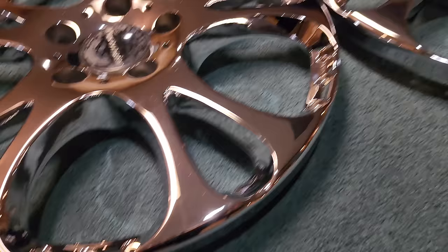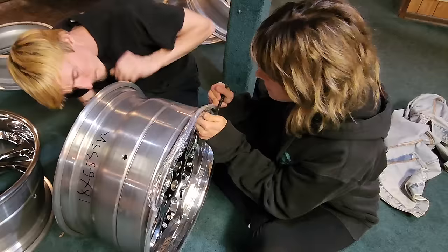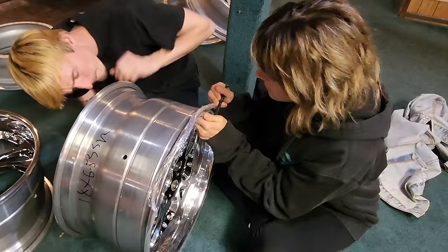These faces came out incredible. Unfortunately, I only have two center caps and they are not in the best condition, so I'm not sure if I'm going to run them or not. My next step is sealing the wheels. I already sealed these two just to get a hang of it before filming. I was planning on taping both sides of the seam, but then I realized the tire is going to be covering the seam. I'll start by pressing in the sealant into the crevice. Once it's coming out evenly, I'll try and pull it down, and if some of it goops up, that's no problem — we'll smear it out after.